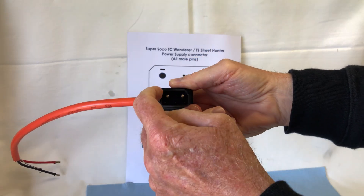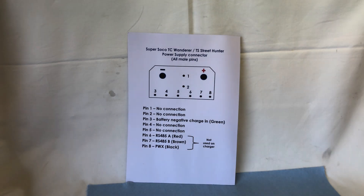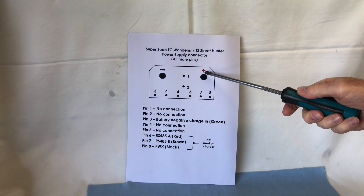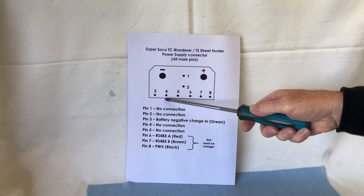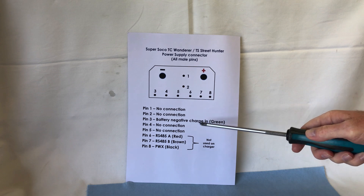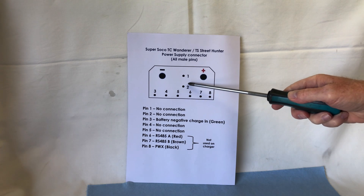These angles on the side are facing up. So if we look at that, you have your plus and minus pins, and then you have pins 1, 2, 3, 4, 5, 6, 7, and 8. Pins 1 and 2 have no connection on them at all — those are the middle two pins.